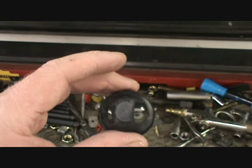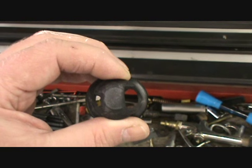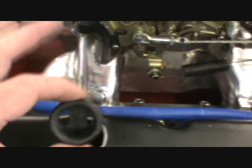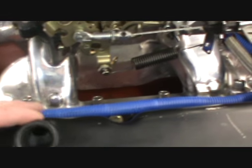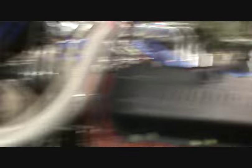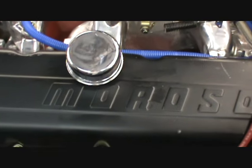That way you can still put oil in your engine and it helps keep it from deflecting. The second trick is when you go to put it in, figure out which way you want it to go so that there's not oil shooting straight up into it. Since the holes are going that way — if you put them where they're going sideways, you're going to end up with a lot more oil coming through. So I always try to turn it so it's basically vertical. Then take your grommet, pop it in there, and pop the breather back in.